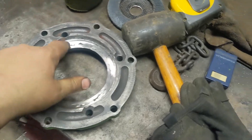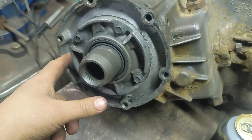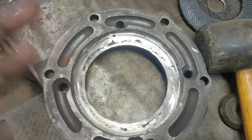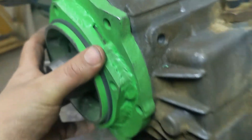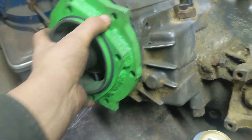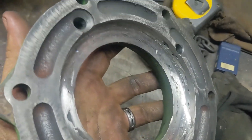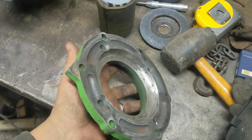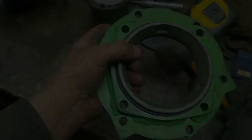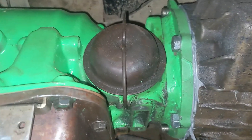As it turns out, this surface in here has to clear the front of the pump on the transfer case, and I had it all full of welds. So I just spent about 40 minutes grinding all of that off so I can get it to sit flush like it's supposed to. Kind of a pain — I'm sure it weakened it some. I know I had good penetration on my weld so hopefully it doesn't weaken it to the point where it's a problem. But this is where we're at — a bunch of grinding. Now we can get the transfer case in.